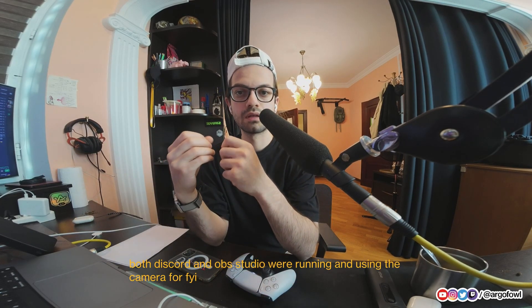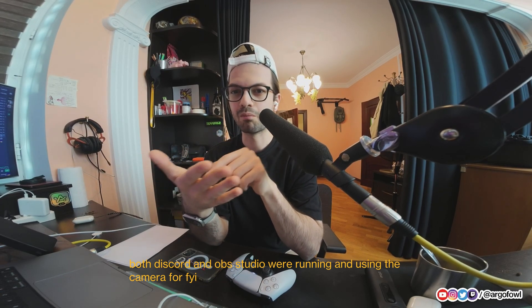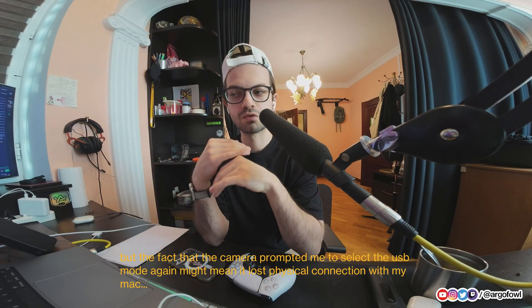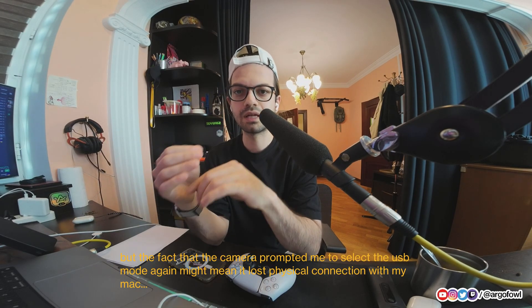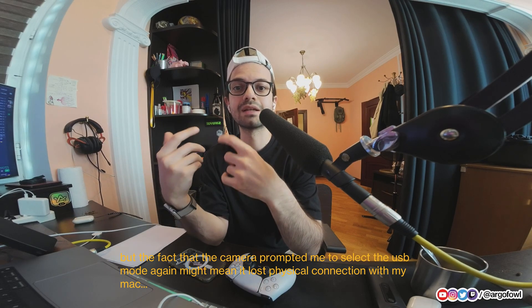That's been my experience so far. If they update it, I'll let you know on X or make another video. Let me double check the battery — it's still at 100%, so we still don't know. Now it's the next day, and I wanted to update you — it's not a good update. I connected the webcam to my Mac to do a live stream, and after 10 minutes the camera disconnected. It sort of restarted and prompted me to choose the mode again — webcam or file transfer. I thought I accidentally disconnected the cable, but that wasn't the case. I reconnected it, put it in webcam mode, and after 5 minutes it did it again. The camera wasn't even hot when that happened, so I don't think it's overheating. I'm not sure what it is.